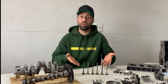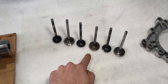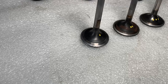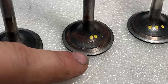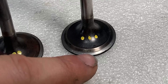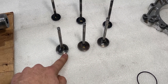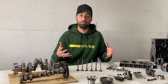That bearing insert isn't the biggest issue on this engine, so now I'll move on to the valves. I have six valves laid out — three smaller valves for the exhaust and three bigger valves for the intake. This is cylinder number one, two, and three. Number one is actually pretty good for the intake; I could probably lap it in again and it would be good to go. But when we compare number one to number two and number three you'll notice a big difference. Number one has a pretty consistent chamfer. Number two is slightly worse — there's a little bump and the surface isn't straight anymore; it has a little radius to it. Number three is even worse — it has a bigger step and an even bigger radius — meaning this surface going up against the valve seat has worn out over time. You always want a chamfer between your valve and valve seat so it seals off properly. If I can reuse these valves and recut them at the machine shop I will, but if I can't I'll need a rebuild kit with more parts.